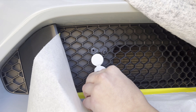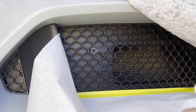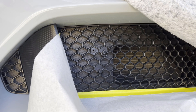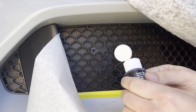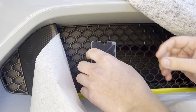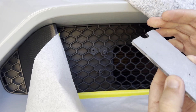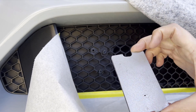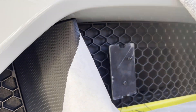You can see in the upper right corner and the bottom middle the little 3D printed prong that I made, which is what I'll drill into to mount the emblem. To figure out where I needed to mark, I put paint on the prong and held the emblem up to the grill to roughly mark where I need to drill and get it lined up. I've got that marked up, drilled the hole, and I'm running both prongs through there to mount it.